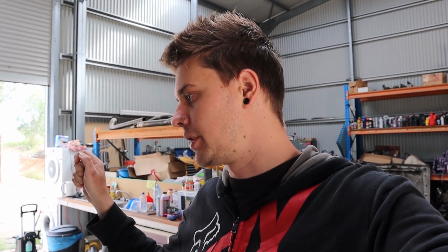So the next thing we did was bridge injector triggers 6 and 8 so that both injector 6 and 8 were being triggered by number 8 trigger instead. That completely removed injector number 6 trigger from the equation, and the issue went away. No misfire, ran up smooth, everything's awesome. So what we did then was bridge 6 with injector trigger 2, because it's the one before 6 in the firing order, so it made more sense for it to be triggered from 2, because it'll fire closer to when it's meant to fire.